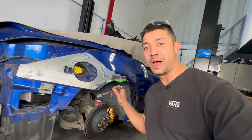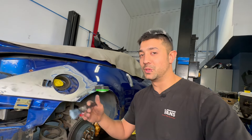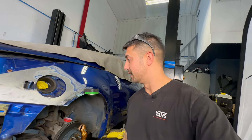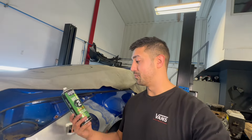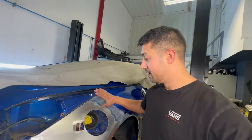I've put rust converter inside - the panel's looking pretty good. I've put rust converter around the lip as well to keep the original spot welds and keep it looking factory once it's finished. I know if I were to drill away from the spot welds on this whole car there'd be rust between the panels - it's just down to how you preserve it and keep the moisture out. Once I finish welding and painting I'm going to put cavity paint down inside, then cavity wax on top, and it should slow any rust down in future. I've cut out the affected area, checked behind it, and put weld-through primer on. I always use the old cut-off pieces as a reference - that's why you go a bit further than the rust.